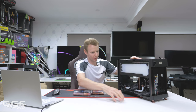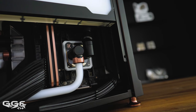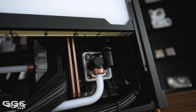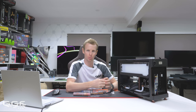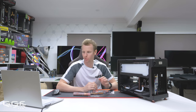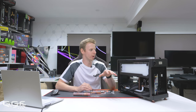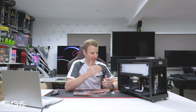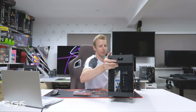Pretty much painted the edges, the fittings, the feet, and also the Antec Katana memory. I left the Katana memory RGB lighting off because I only used a light paint - I wanted to see how light went through when on, but because I painted it lightly you could see imperfections when backlit; it was kind of dotted and transparent rather than a solid light. So I left it off to keep it in line with the rest of the theme. The motherboard tray was also repainted because once I cut it down it got a bit scratched.